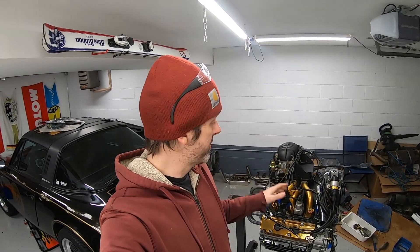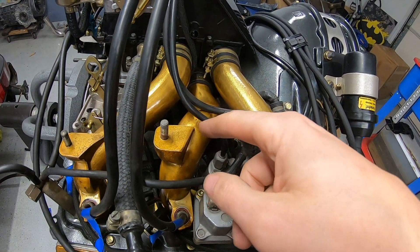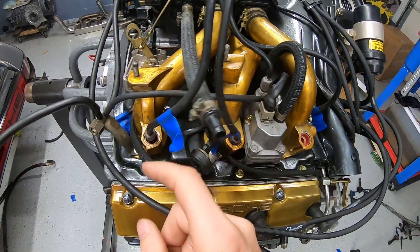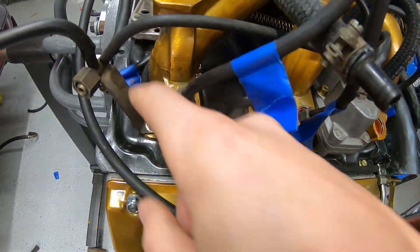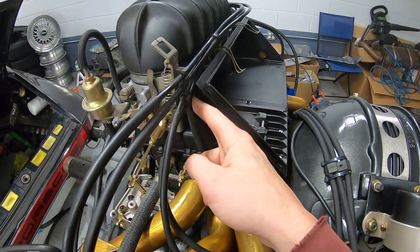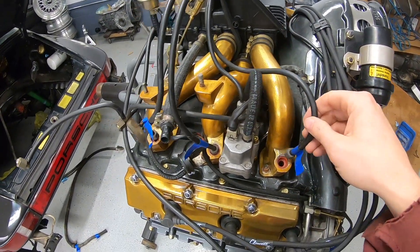That about wraps up the intake and fuel system for this episode. Other than the fuel injectors, I have everything hooked up. On a '77, you're only going to have one vacuum line coming from your distributor. That runs to a T intersection — one side goes to the lower port of the throttle body, and the other goes to the center of the warm-up unit I've mounted on the intake. The other line goes around, turns into a bigger hose, and comes into the top of the unit, while the other throttle body line goes straight down into the back. I've tried to tuck as much of the hoses underneath the intake runners to show those off.